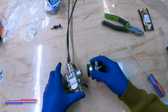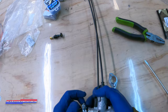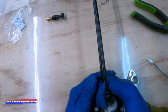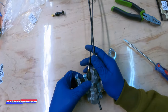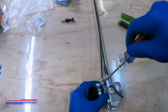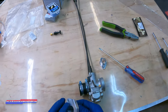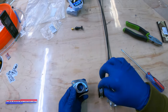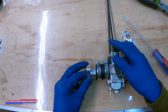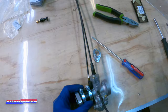Next step is to put on this boot. Depending on what side of the bike you're working on — this is going to be your CVT side. I typically like to have the hose clamps facing the CVT side personally, because that's where I end up doing most of my work — you're not working above an exhaust, a little bit more accessible. So keep that in mind when you put your hose clamps on. You're going to shove this guy on like so. The rubber boot is made really tight so they're not popping off — we have seen carburetors where the actual boots just pop off all the time. Once you get that boot snugged up and solid, take your billet adapter and slide it in here. Make sure that the threaded screw section is up at the bottom, because if it's on the side, the bolts coming through the intake manifold are going to contact those screws.